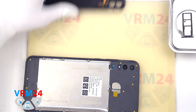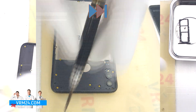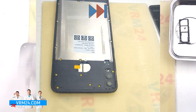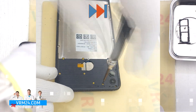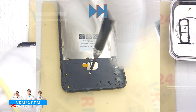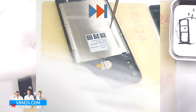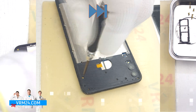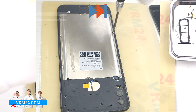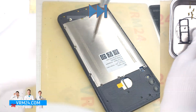After that we move on to unscrewing the screws. For this we use a Phillips screwdriver 1.5 mm or Phillips #00. If the screws are badly loosened we can use a magnetizer; if they get stuck we can use tweezers. It is better to place the screws on a special surface in a certain order, because the screws are different in color and possibly in size.